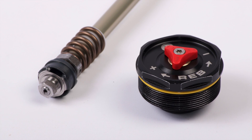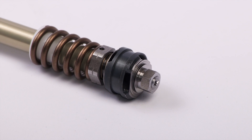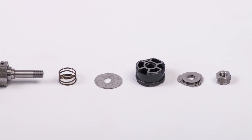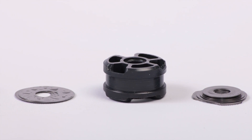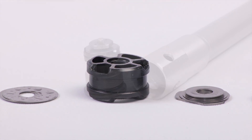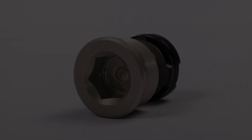Explorer right side. With Explorer, the two fork legs are not symmetrical. The right leg provides all the rebound damping and about two-thirds of the compression damping. The layout of the base valve, mid valve, and rebound is familiar, but WP uses stiff valving settings to consolidate most of the damping force into one leg. The Explorer rebound adjuster controls fluid flow at the rebound piston, which is the standard setup and is quite effective at fine-tuning rebound control. The base valve is non-adjustable and the cartridge tube is sealed, with no leak other than a tiny gap between the cartridge bushing and the damper rod.